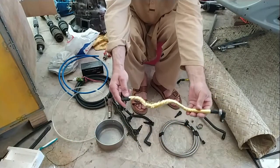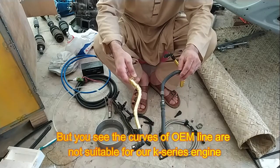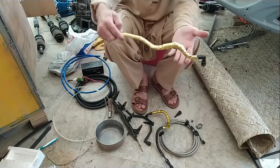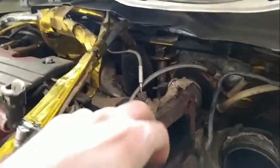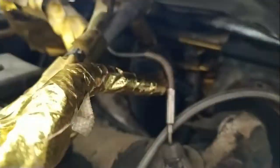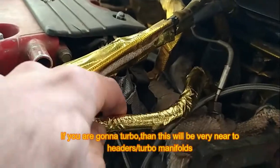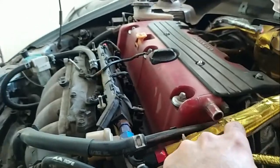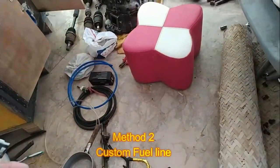The problem with the end product is that the curves are designed for the older engine. For the K-series, the exhaust setup is different, especially if you are turbocharged — you cannot un-kink these hard curves. The fuel hard pipe starts from below, and when fitted, the pipe sits almost one inch above the exhaust. I did wrap it, but the proximity to the exhaust was always a concern. That is the problem, so let me tell you Method 2.